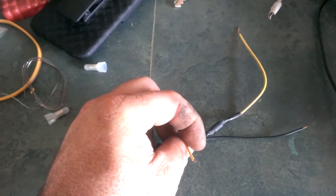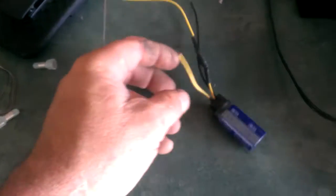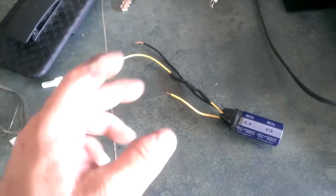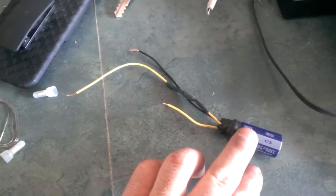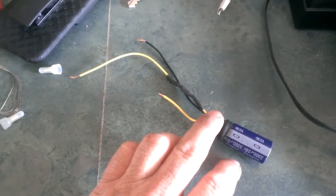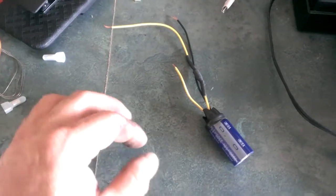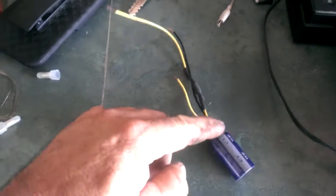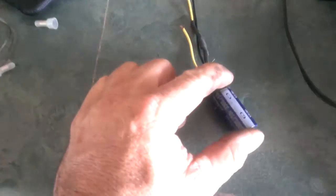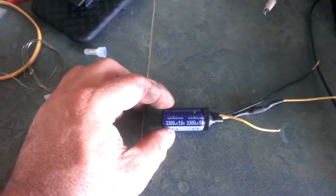The output from the capacitor is going to go into the memory wire into the radio. What this will do is, when you disconnect the battery, this will not drain right away. This will actually hold — like 12 volts — feeding the memory wire to the radio. And because of the diode, it will not back-feed to the rest of the car and just discharge the capacitor instantly. The capacitor is just going to discharge however much current it draws to hold the memory.